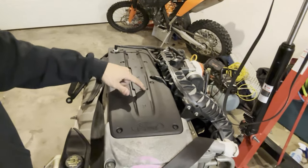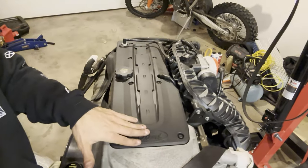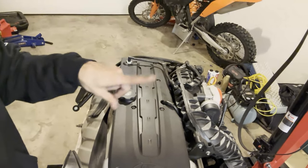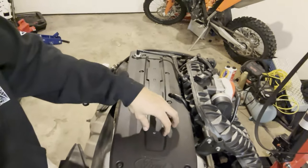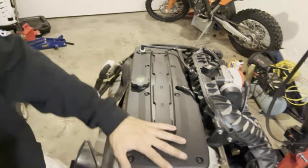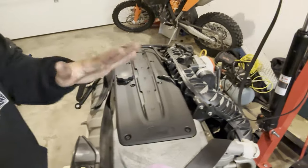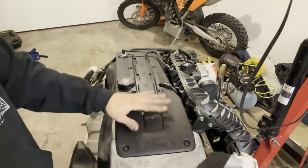And we're going to pull each and every single one of these lovely six spark plugs and just see what they look like, and then maybe I'll look down the cylinder. I don't have a little camera that'll stick down there, but just so I can visually see it. I did already move the oil cap. See how the spark plugs look, kind of tell the health of the motor. Like I said, 198,000-ish kilometers on an automatic, so in my eyes, very healthy.